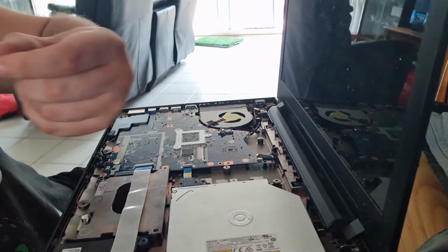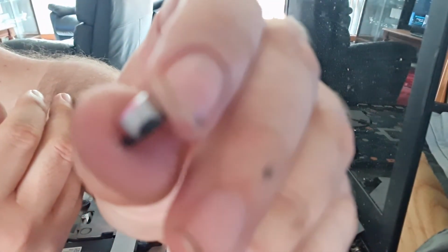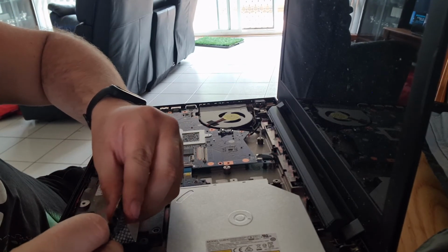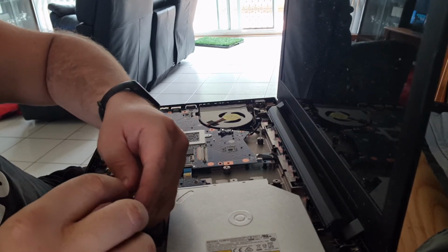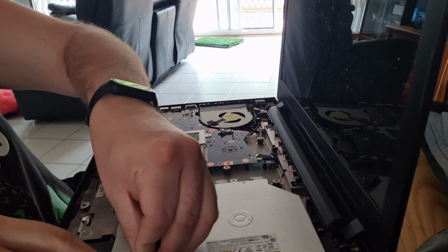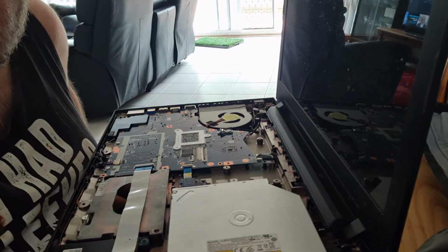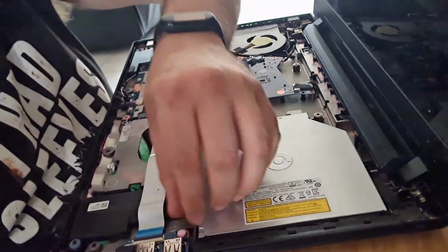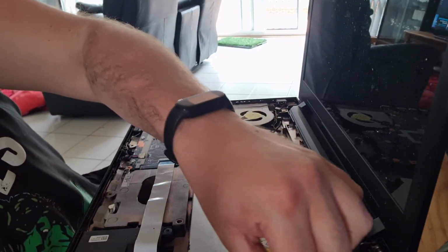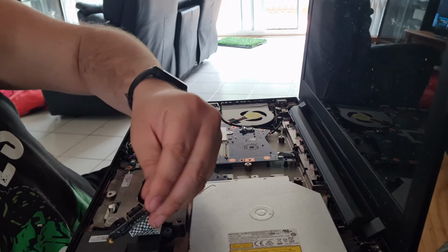Oh, and, of course, there's a capacitor broken. This is what I was looking for. There is a capacitor that's broken off. And it looks like it probably broke off the motherboard, somewhere around here. Might have been here that it broke off. So there's a capacitor here that went here, and that's the reason that the USB is fucked. So that capacitor broke off. You can actually see the little capacitor, and it's broken off. So, yeah, it's pretty fucked, let's be honest. It's fucked up that they smashed it so badly that it dislodged a capacitor. And that's the reason she had issues with it.